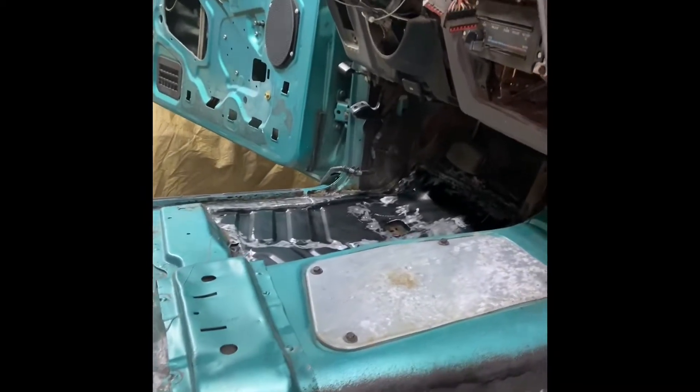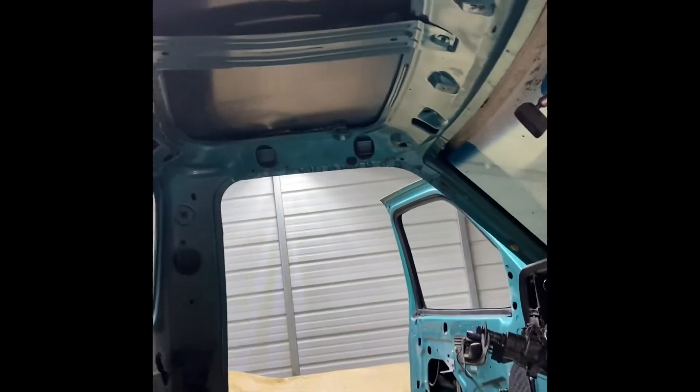I've got all that cleaned up and wiped down — same over here, cleaned up, wiped down, ready to spray. Door jamb is also done and the back too. I'm going to prime these areas first with the rust preventative around the doors and the inside and outside of the rear window. Then I'm going to put the truck bed coating on the floor. Once we let all that dry tomorrow, I'll go back and put seam sealer around all the welds to make sure they're good and tight. I think the main reason all this rusted out real bad was due to body filler — it was everywhere there was heavy rust and it looked like it had been put on before the rust. Let's get painting.